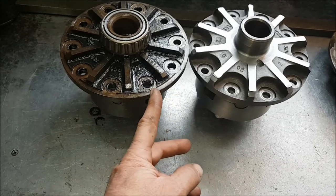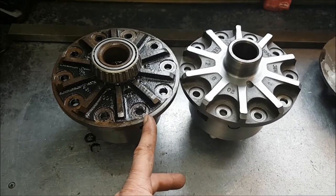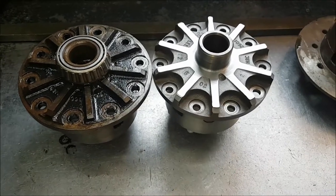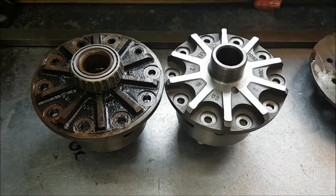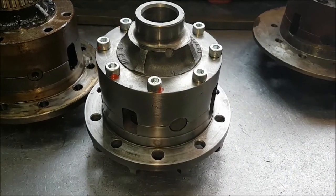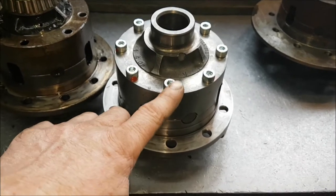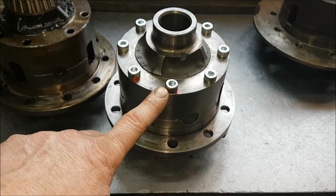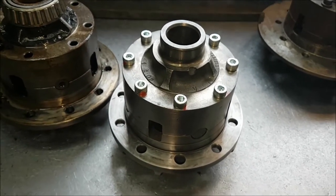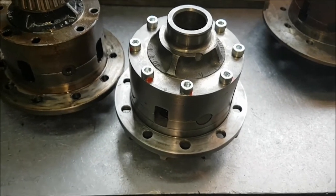And this is your standard V890 or military four pin, both 24 spline. This one, as you can see, has also had a bit of loving and a bit of upgrading. And we do quite a lot when we upgrade these. This one's been completely stripped, all new thrusts put in, and then we've upgraded the bolts here to the 12.9 grade bolts. This is going to be built into a standard long nose case, because now it's been machined and modified heavily, it will fit.